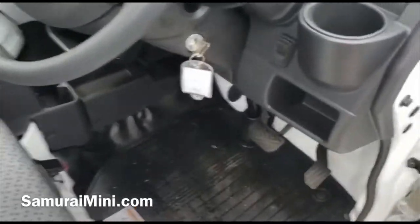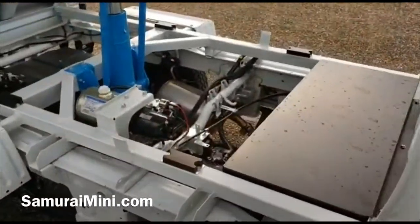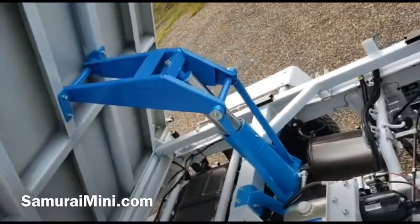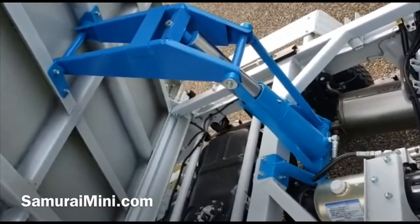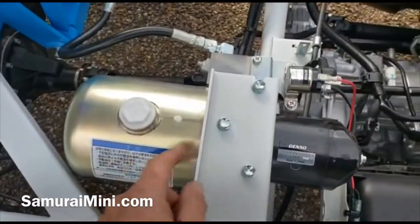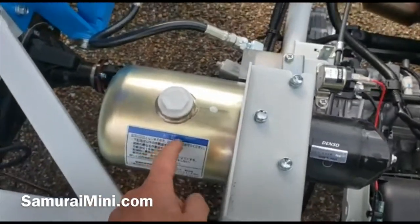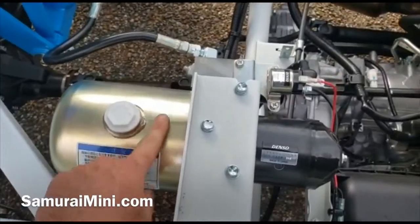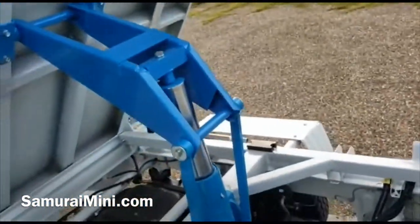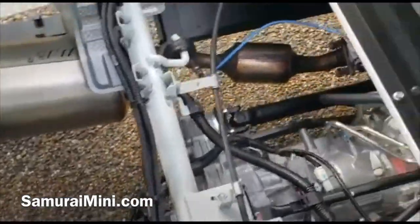The dump button to operate is there, but I've already got the dump up. You can see it's a nice, well-made, strong steel bracket which incorporates the hydraulic ram. That ram is operated by this motor — it's a good manufacturer of electronic equipment — and that powers it using oil from this tank, pushing oil through this pipe to force the ram up, which puts the dump up. Very simple, not going to cause too many problems.